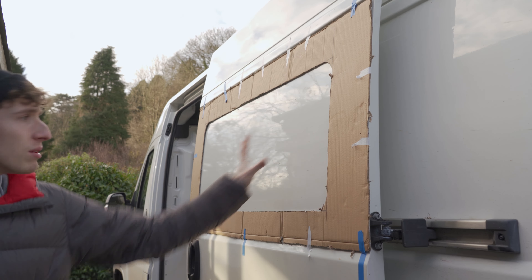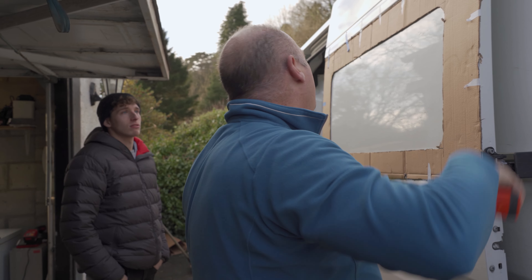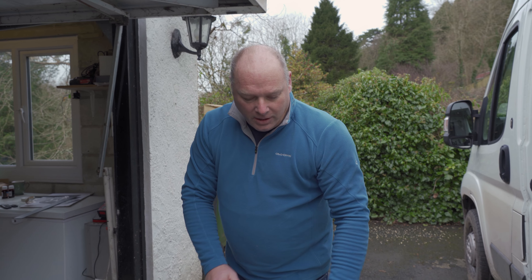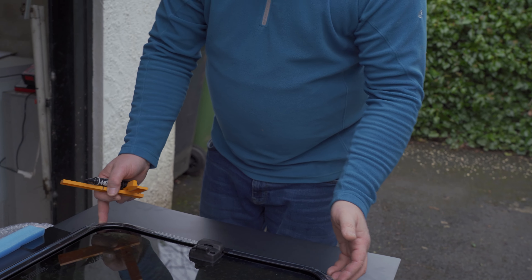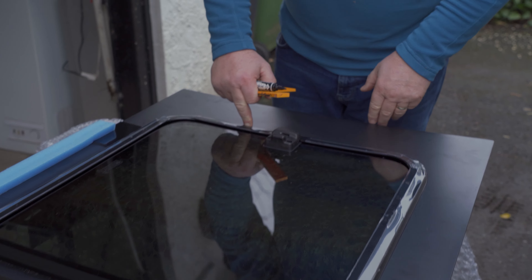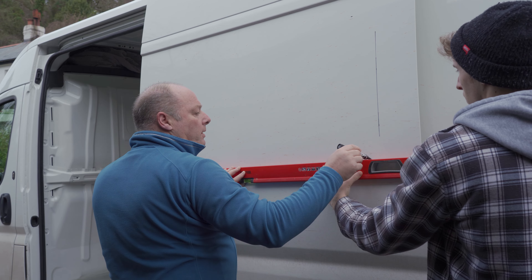Just taping it up. Measure, measure. So that side... that's going to be the window. This window fits exactly inside the door recess. Normally most people have windows without sliding parts, but this one's got the slider — it retains the sliding section. So it's actually wider; you have to cut the window hole wider than normal. Normally you just measure up to the transparent bit of the window, but now we've got to measure from the outside edges to each side and the bottom, then mark it up and cut it out.